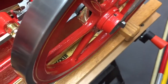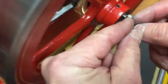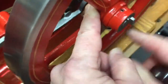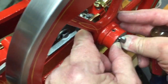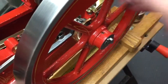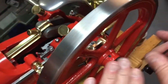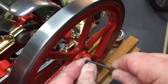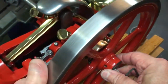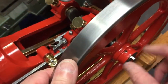Just enough room that if you want to take it out you can put a screwdriver in here and pry that out. Don't put this edge of the key smack up against the edge of the flywheel. So this is flush — that goes in like that. Then you have your three set screws to tighten. Don't kill them when you're tightening them. Turn them in till they touch and then give it just a little nudge — about that much. Otherwise you're going to gouge the crank end and overly gouge the keyway.